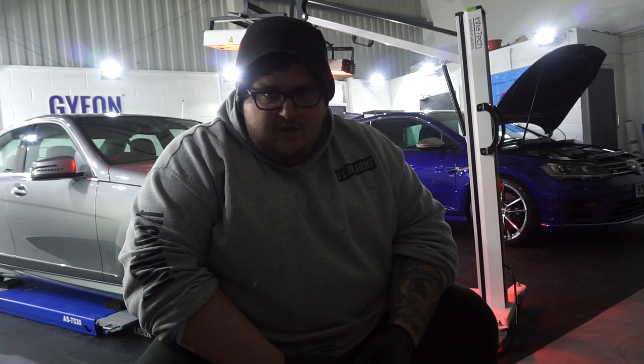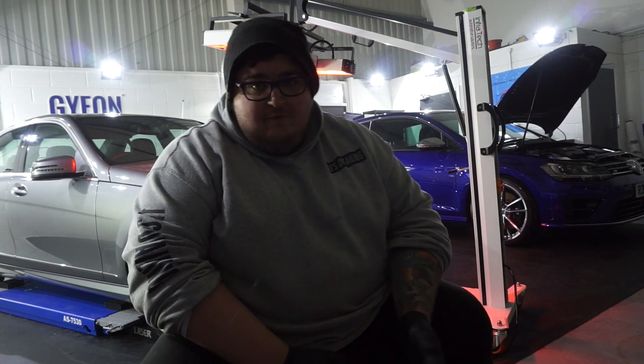It's had numerous coatings and things like that in the past. Customer was never really 100% happy with them. A lot of cloudiness from the coating. That's normally where coating hasn't been removed correctly, so it creates a cloudy effect. But because the car has been polished a few times in the past, machine polish corrected, it left the paint very thin and very fragile.